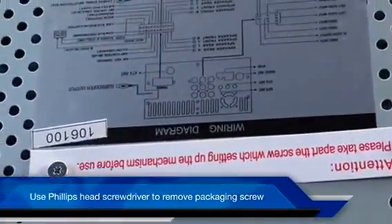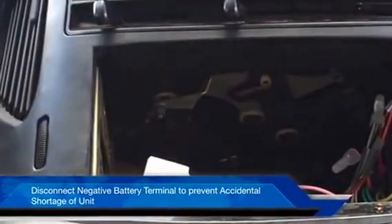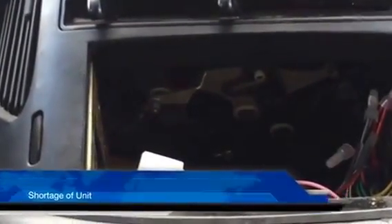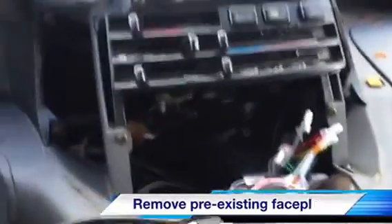We'll bring this outside and get it installed. Before getting started with the radio, two things have to happen: first, the top screws and the paper need to come off, which is easy enough. With that piece of paper off, I need to go up to the hood and disconnect the negative terminal of the battery. I've got my dash taken completely off and all of my wires together — I did not need an adapter; I used the original one that was in there.